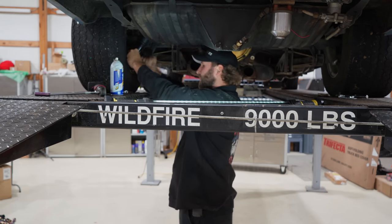Spring, pop the throttle off. This is a vacuum secondary. We're going to be moving to a mechanical secondary. So whether it wants to open or not, you're getting the four barrels. You know what I mean? It's just like flipping the lid on the air cleaner. Automatic horsepower. All right, I need a screwdriver, ratchet, open end. This should come off just fine, 10-4.